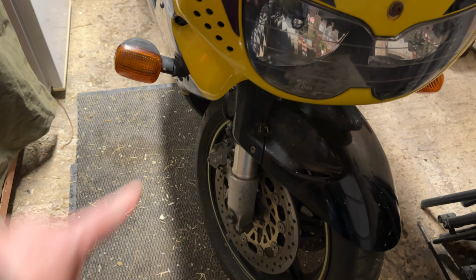So yeah, lots to do, and I'm sure we'll be finding things to do as we go along. I mean, I think a gerbil lived in it at one point. Battery's kind of running, but it won't start the bike. It does turn over, though. Look, lots of surface rust, bits and pieces to clean up completely. Rear shock may need to be replaced or rebuilt. But we'll get on with our first job, which is getting the tank off.